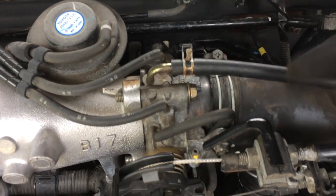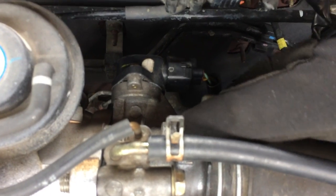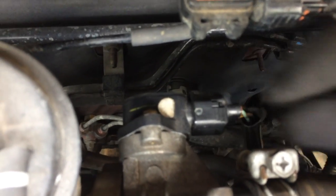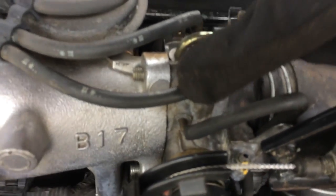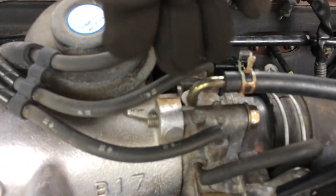When you go to take this off, there's a 10-millimeter clamp here. Loosen that up and pull this air hose off. Give a squeeze on the electrical connector to the throttle position sensor and remove that. Coming around to the front, there's a gray connector on this idle air control valve — same deal on Toyota, give it a squeeze and wiggle it off. Get a piece of tape and mark this first hose so you know where it goes, then remove these two vacuum hoses for the EGR system.